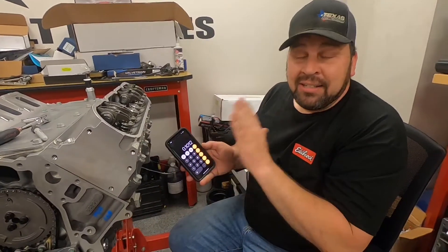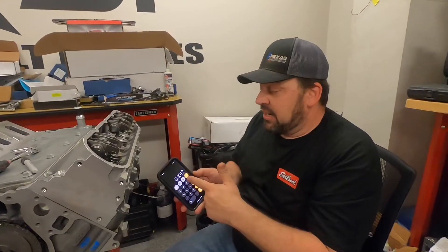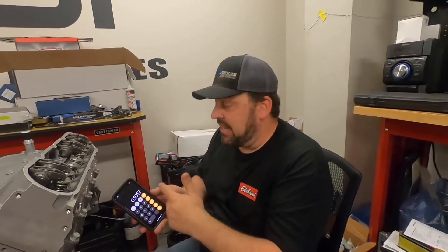A lot of LS7-style lifters, or the LS3 replacement OEM lifter, if you actually measure it before you pull it apart, it'll be between about 100 thousandths to about 110 thousandths. So just slamming off-the-shelf parts in, we have our target number easily. We could actually go 25 thousandths shorter, like a 7.375, and still be right. But a 7.450 would be way wrong, because it would add another 50 thousandths, which would be at the end of travel for the lifter.